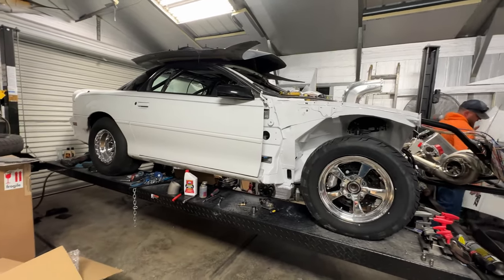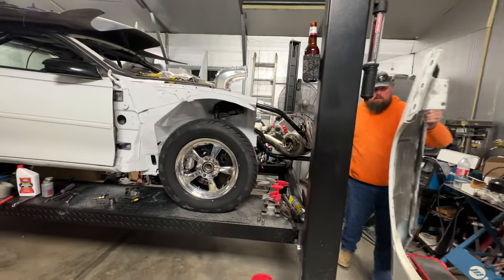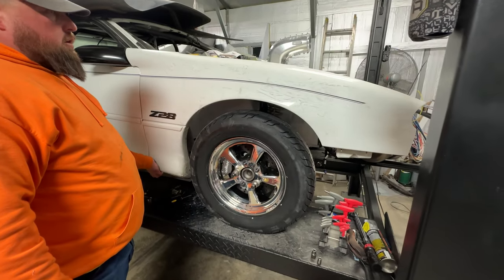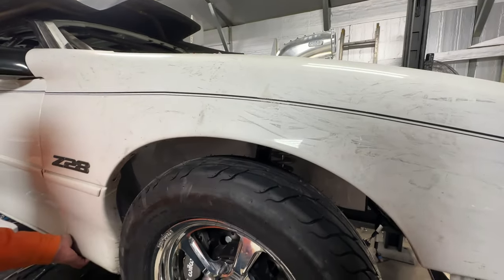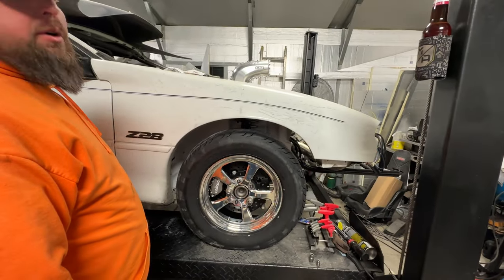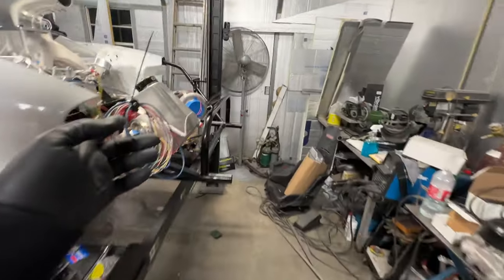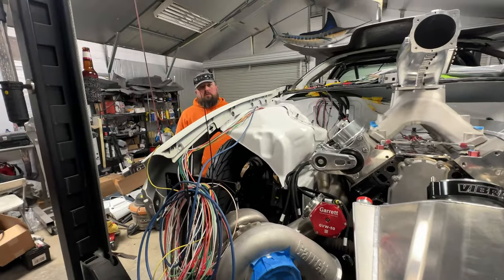I still think we're definitely plenty high in the back. Oscar can grab our dirty fender and see how close we are. I bet that's close on ride height. So I'd assume we could maybe go, which I think we're probably close, and then obviously we'll get more weight in the front end and it'll come down some, but that's probably not way far off. I think about one more inch on the shocks. It all depends on how much, but we still got hood, ice water tank full, radiator full, so it'll definitely gain some weight.